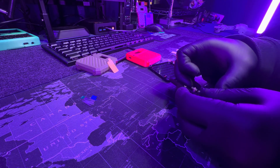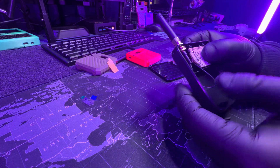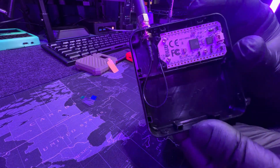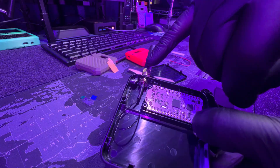There's a little antenna plug-in you're going to connect right on the side of the screen. It's very tough to push in, so I recommend getting it as level as you can and then using a screwdriver to force it down so it doesn't hurt your fingers. Once you do that, place it in with the USB-C port facing the actual cutout for it. Tuck the little antenna wire to the left and everything fits really nice. You'll know if you did it right because it'll just feel right.